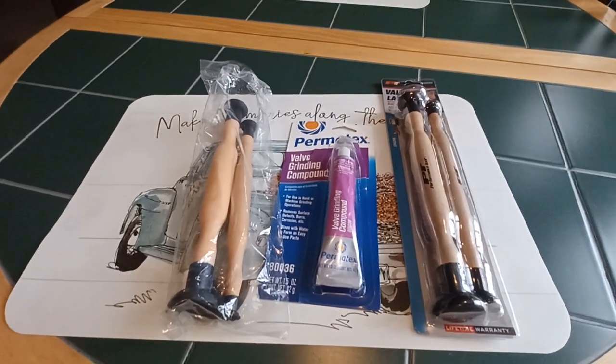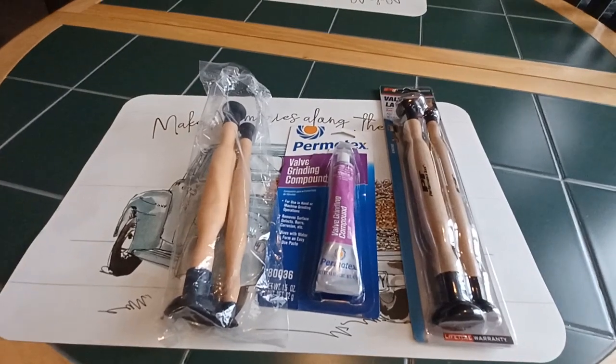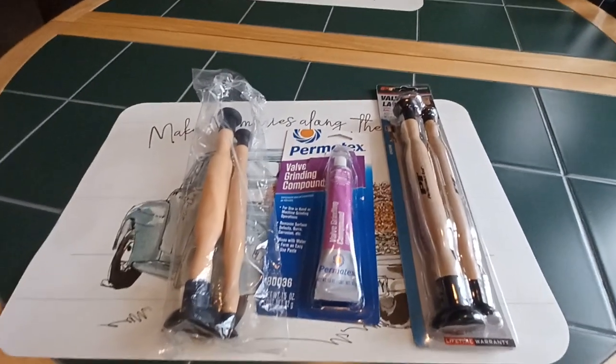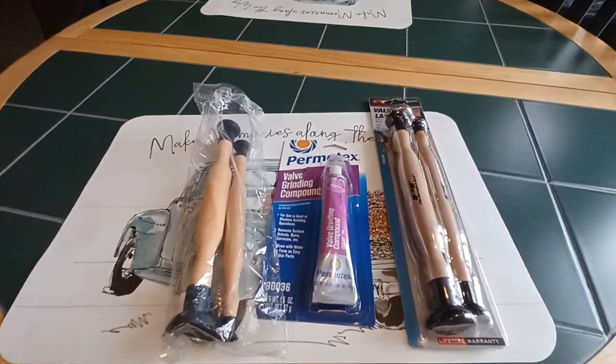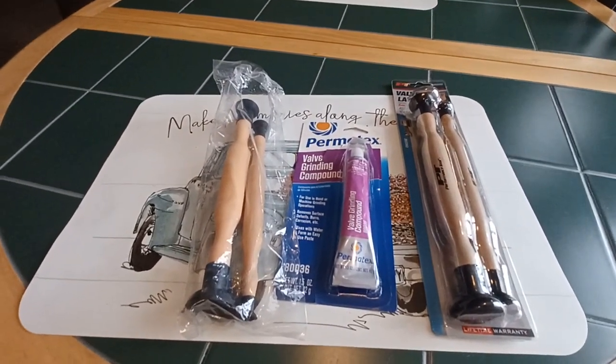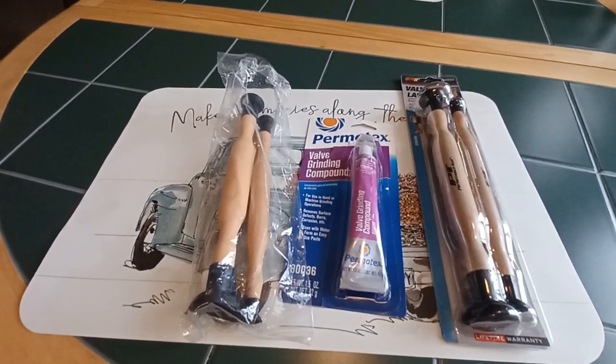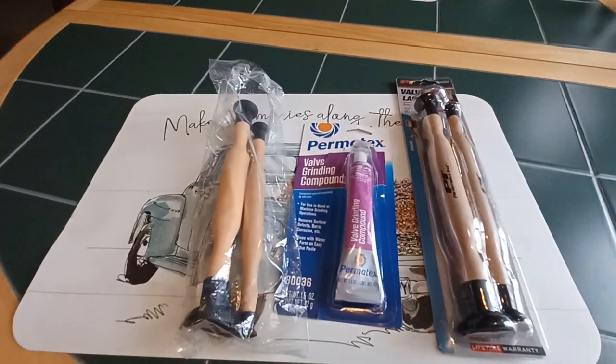One pulled it off and took my deposit, and a couple hours later called me and told me that the head was junk, so they couldn't sell it to me. So I instead went the route of just pulling out the burnt valve, as I showed in my video, and replaced it with a DNJ valve that got pretty good reviews for their parts, and lapped it in.